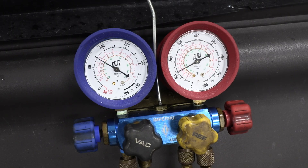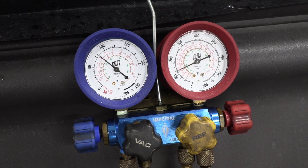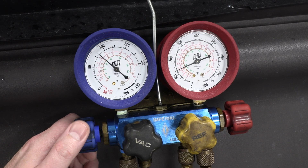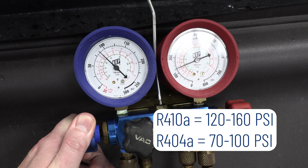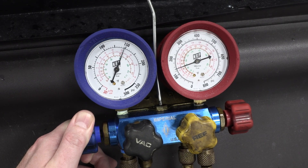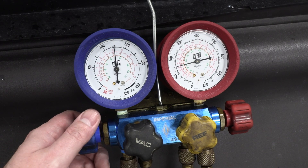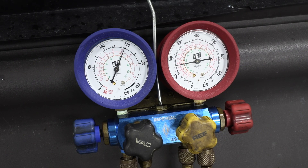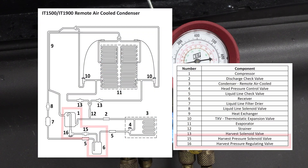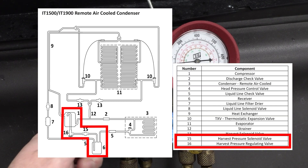We're in harvest, and as you see we have the low and low again. What we're going to do now is — I have this yellow knob opened up a little bit, and remember, this yellow hose is going to the top of our receiver. I'm going to slightly open up the suction side and meter refrigerant — for a 410 machine, somewhere between 120 and 160 PSI. I like to take it right around 150. What you'll see is the discharge side is going to come up and start to get into the normal range according to the chart. As we start to flood that evaporator, we're going to keep opening it and monitoring it. We're essentially acting as the HPR — because what the HPR does, if you look at the diagram here, is take vapor refrigerant off the top of the receiver and put it into the suction side. We're doing that same thing here with our manifold gauge to help the ice fall off the plate.